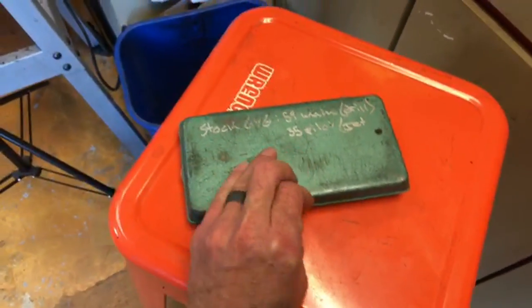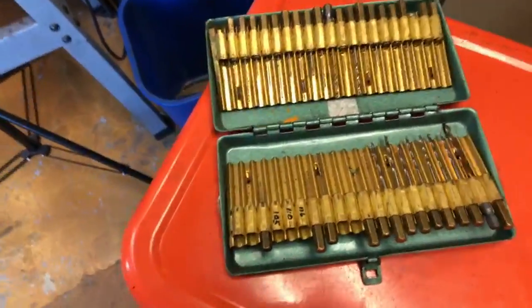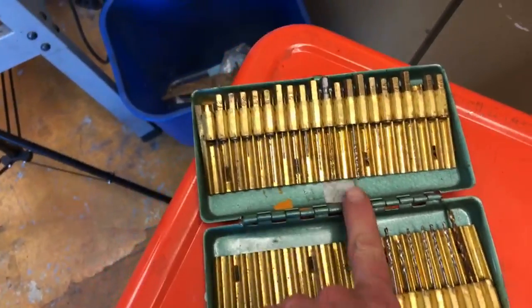And let me see, what I would recommend, you can do half sizes. Check this out. I went to a hobby store. Actually this is for a furnace, but you can find these at hobby stores. These are tiny little drill bits. If you don't have the proper jets, you can use jet drills, and you can also go to a Fastenal and get all the different sizes of drill bits to drill them out, because a lot of times that's the issue with jetting, you don't have the proper jets to do it. That's a little hack. And if you go too big, you can always solder it shut, put a little solder in there, heat it up with a torch, and drill it out again. That's actually the way I do almost all of them, because it's more precise anyway. That's what I'd recommend. Hopefully that answered that. But 4 turns is kind of the limit. It should be more like 2 to 3 turns.